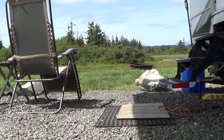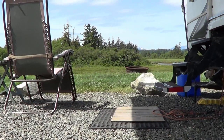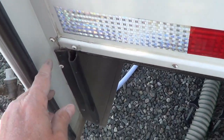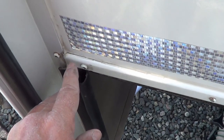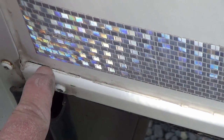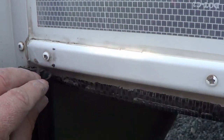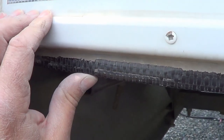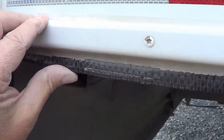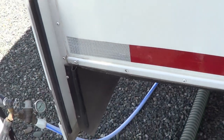First up is a leak — a little leak in my slide. Let me show you that. Here's where the problem I spotted is. If you look really close, you can see a small crack has developed just in that corner seam there. When I go underneath, it feels like the wood is a bit spongy, so I believe water has gotten in there. I'm going to pull that strip off and have a look.